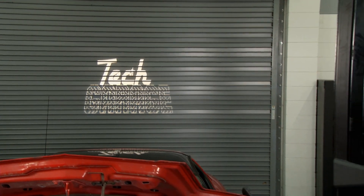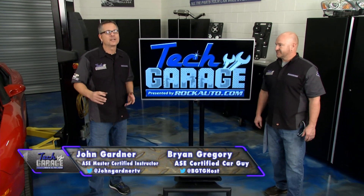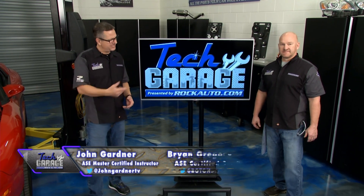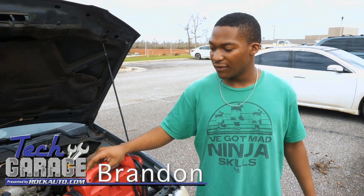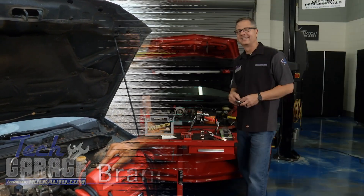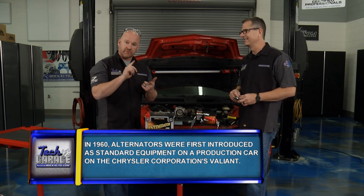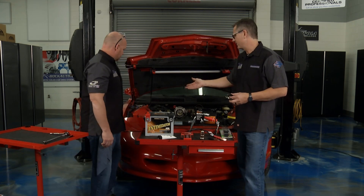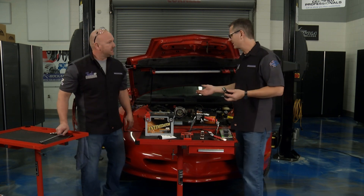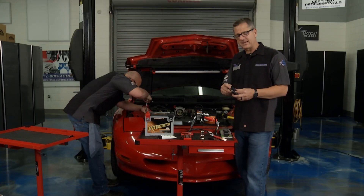One of our favorite segments is the video question of the week — and this one we can all relate to: jump-starting a vehicle when you have a dead battery. Hey John and Brian, I've been having to jump my car for the last month. My battery is relatively new and my alternator is new — can you please help me out? Brandon, you gave us a clue — you said your alternator was about a month old. So a logical starting point is the battery — you have to make sure it can receive and store all the energy that alternator is making. Our Firebird is five or six years old and with a lot of electrical load, batteries aren't lasting forever anymore.